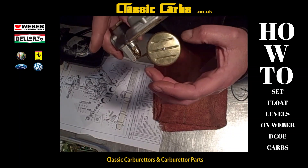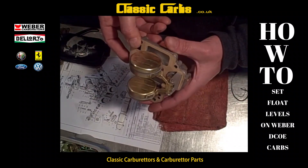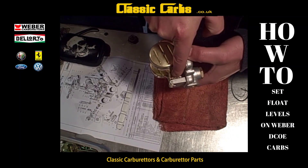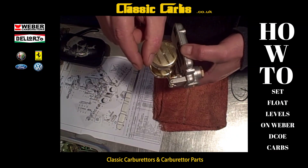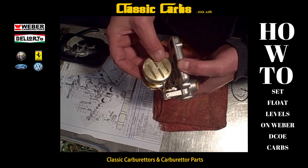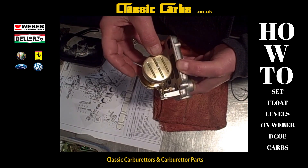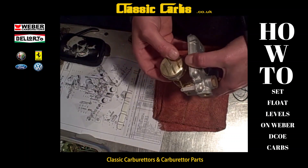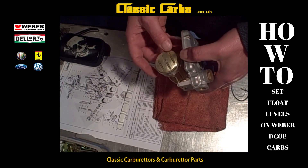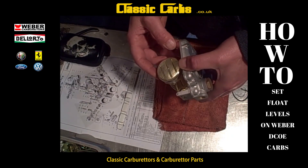This does take a bit of getting used to. If you look closely at the edge of the needle valve assembly, there's a little ball that's spring-loaded — very, very light. You need to make sure you're not adding excessive load on that, because that will just shut it. That's me depressing it with my finger. So that's fully open, and that's fully closed.